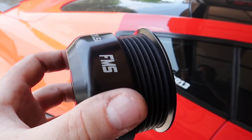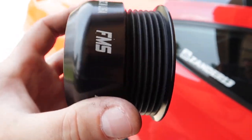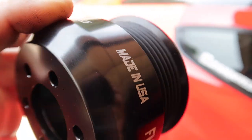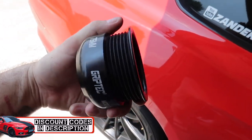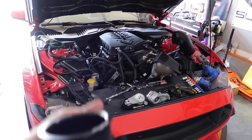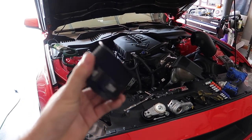The 69 is about 4 or 5 PSI over this one, and this is about 4 or 5 PSI over what we are replacing. Look at the texturing inside this GripTech — that's supposed to help prevent belt slip. You can see how that's gonna grab like little teeth onto the belt. There's the website you can go to for information or you can go to modernmuscleperformance.net. They were actually the ones that sent this out to me since they supplied much of the rest of the blower setup. They reached out and said hey, you want to go faster, and I said yes, absolutely.